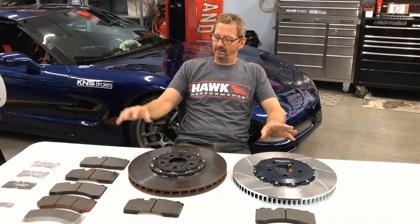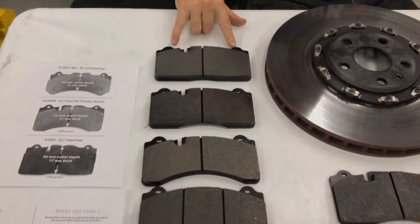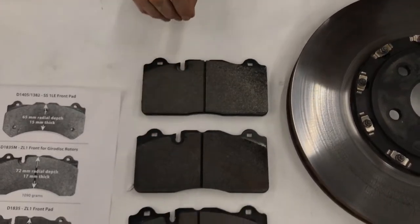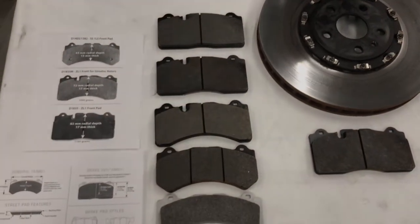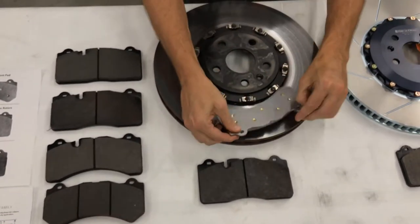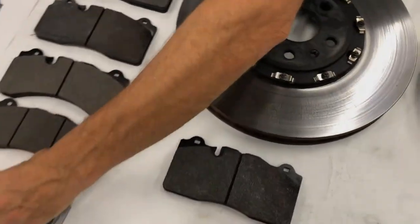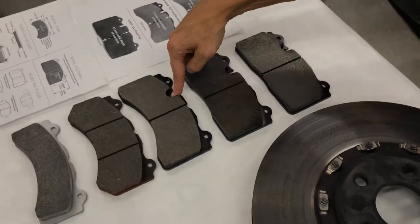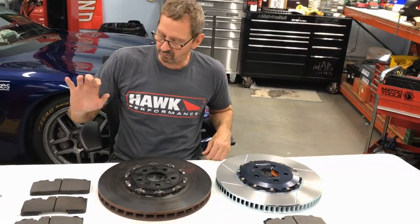If you look here you'll see there's a variety of the Brembo 6-piston caliper brake pads and they all share the same kind of dimensions — the relationship of the pinholes to the upper contour of the brake pad. The only thing that really changes throughout the range is the radial depth, and you can see from the widest to the narrowest there is quite a bit of difference. This pad would in fact fit in your ZL1, though it would not cover enough of the brake disc. These pins and this upper contour share the same relationship. You can also see they all have the same little divot here — that's just a sensor notch for pad wear sensors in certain cars.